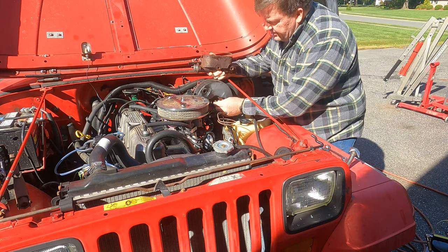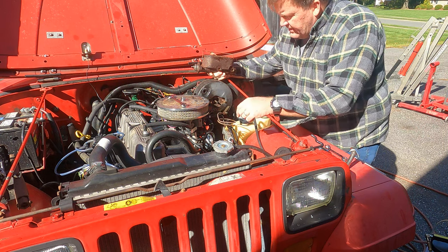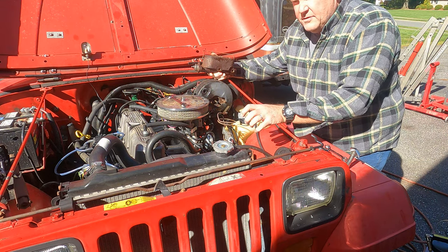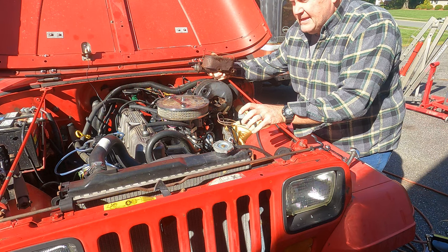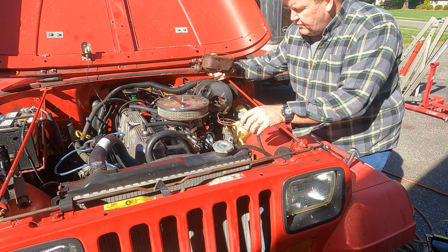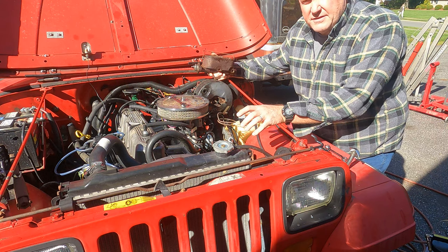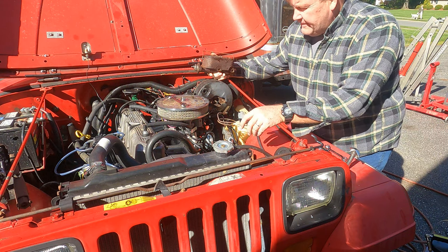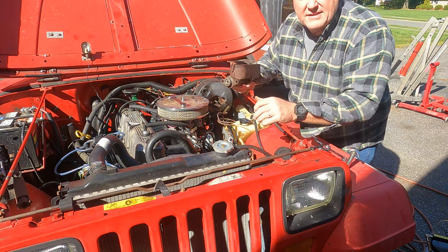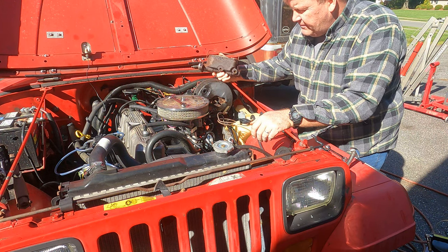Interestingly enough, inside here is a little push rod, and you'll notice it has an adjustable screw on the end of it. That is what sets, for lack of a better term, kind of preload on your brake system and how responsive your pedal is to braking. You don't want to tighten that up too tight, but if your pedal, even after replacing the master cylinder, is still a little squishy, you may need to actually crank this out a little bit to get more pressure pushing on the piston that's actually inside the master cylinder. So take a look at that if you have that problem.